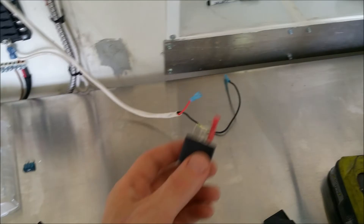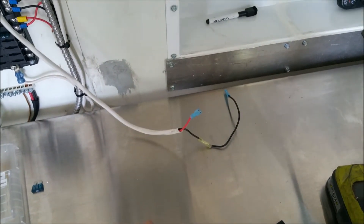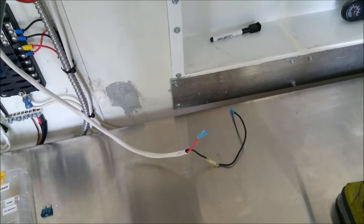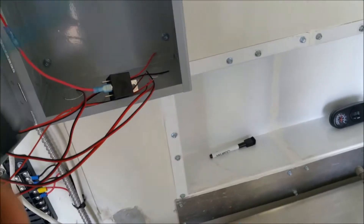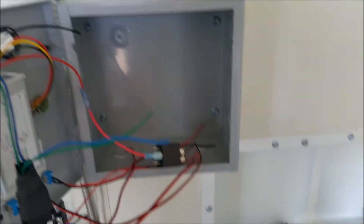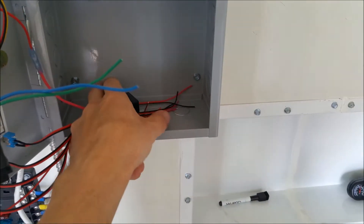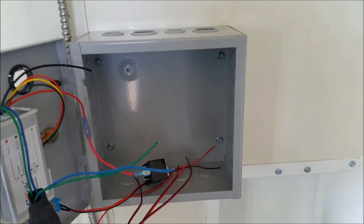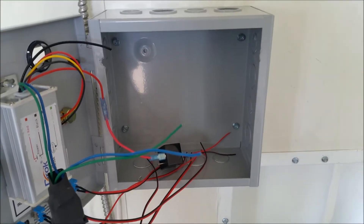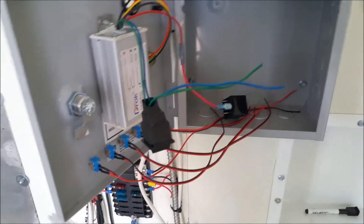I'm running out of relays so I have to order more of those. But my goal basically is to get the water pump wired in today and the thermostat wired to the fans. I've got to punch a hole — I think the best spot is going to be right here — about a one-inch hole. Run some PVC down to the bed to protect the wires, then we're ready to start doing some terminations.